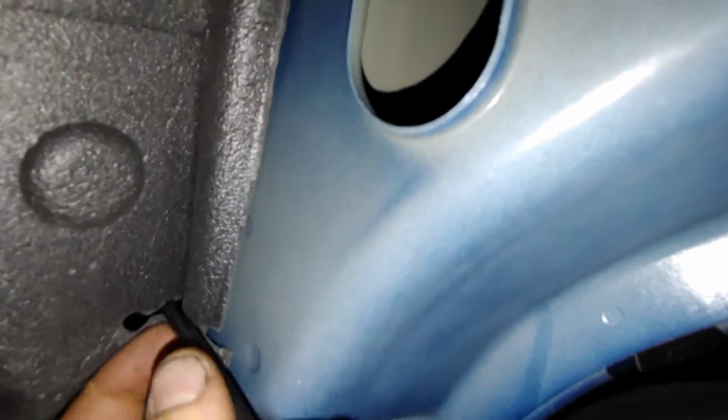Alright, we got those bolts out. Get this out of the way and you see the antenna is just hanging there. You can get a better smoke inside, look in here. Isolating that part that you think might be leaking can lead to actual diagnosis. In some cases, you're not even going to pressure check the turbocharger because it's a solid metal housing and very rarely will those leak. But you can use a smoke machine to check the diverter valve to make sure it's not leaking all over the place.